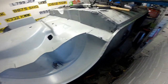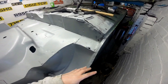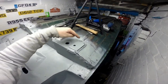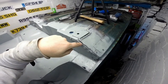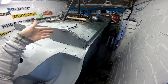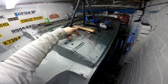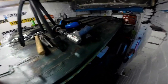That wheel arch is all cleaned up now. And when I was cleaning it up, I found a hole there. So what I'm thinking of doing is, obviously, if you look at this floor here, I've cleaned a tiny bit of the floor up, so it looks like there's a join here. So obviously somebody's just plonked it over the top, there's a hole there. So what I'm thinking of doing, because I've got a snap bolt there, I'm going to put a little closing panel in here, and I'm going to cut the floor to half, flange both sides, and then spot weld all the way across. As we come down here,